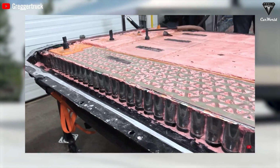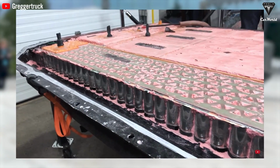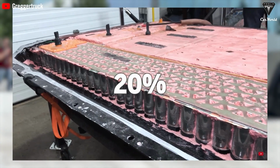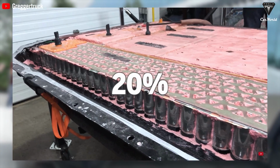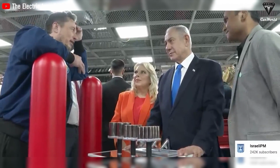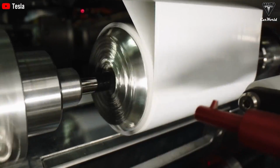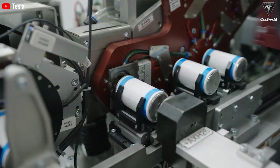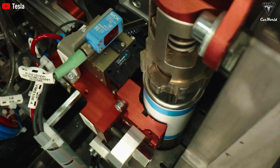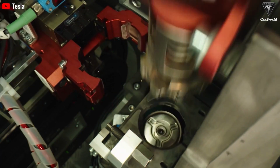Cybertruck's battery cells indeed contain a small amount of silicon in their anodes, and Tesla has mentioned the potential to increase the battery range by 20% due to the integration of silicon in the 4680 battery anode. This could be a major breakthrough if Tesla's predictions come true. A recent Tesla patent describes the method for multi-layer electrode films, where the main issue is the poor adhesion of the active material layer, like graphite, to the metal foil, leading to electrical loss and reduced storage capacity.